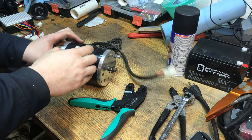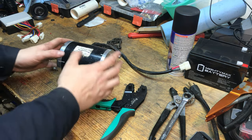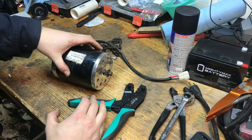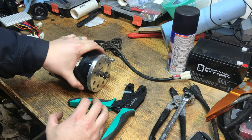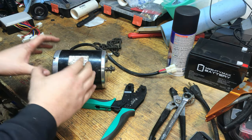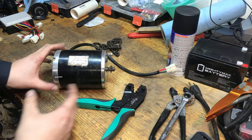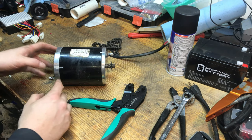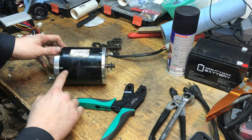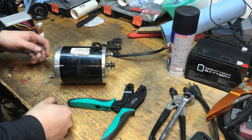All right, moving on to the bearings. First thing I would do before we take this apart is get your pictures of how this thing goes. Labels here, as you can read, and on the right side you have the sprockets, remember that. And then to keep these plates, the end caps, lined up, I just go ahead and take a paint marker and draw across both sides, so it helps out lining this up.